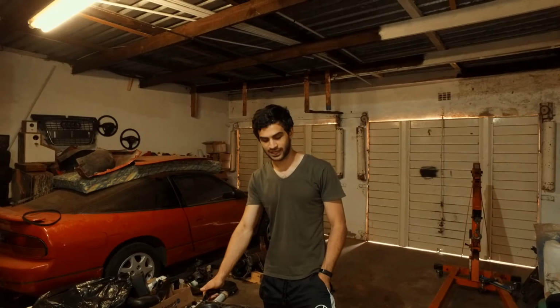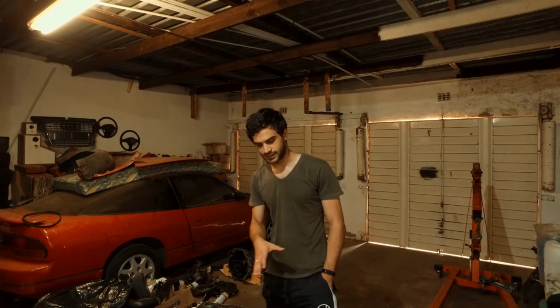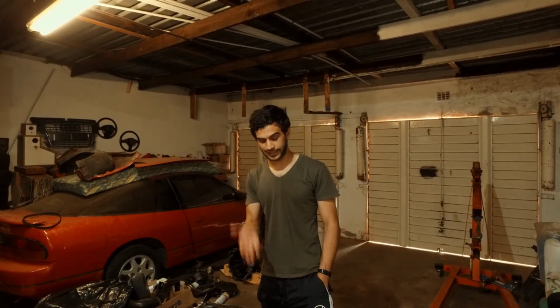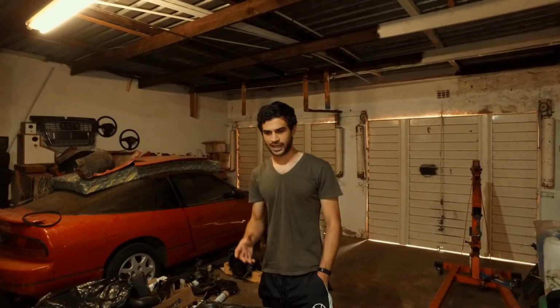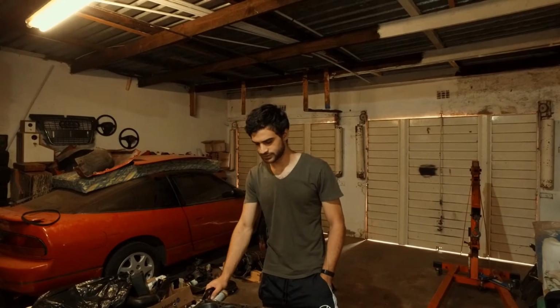So after hours and hours of checking, eventually we found out that the bores are oversized. My bores come in at around 83.5 instead of the 83.03 that they're supposed to be. And then stressing about needing to buy new pistons, after going around and measuring the pistons, found out that the pistons are oversized also.